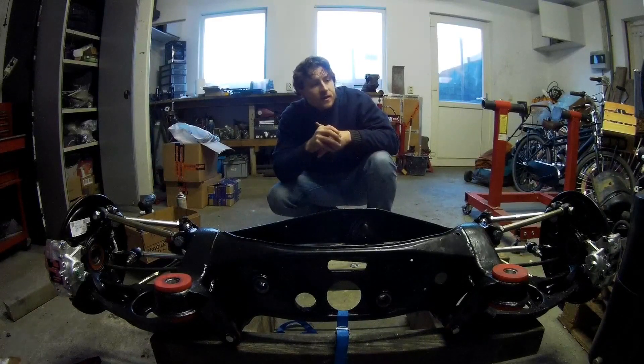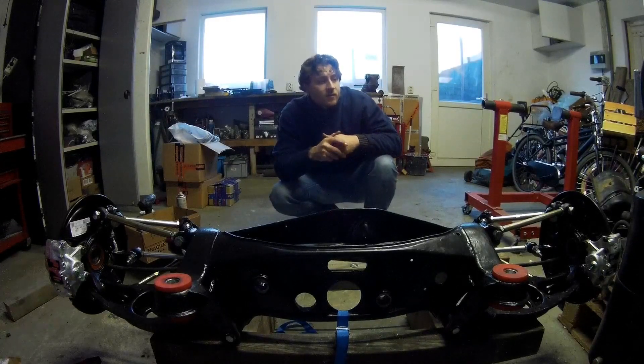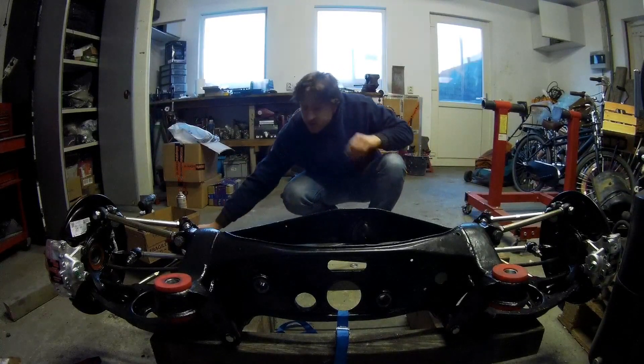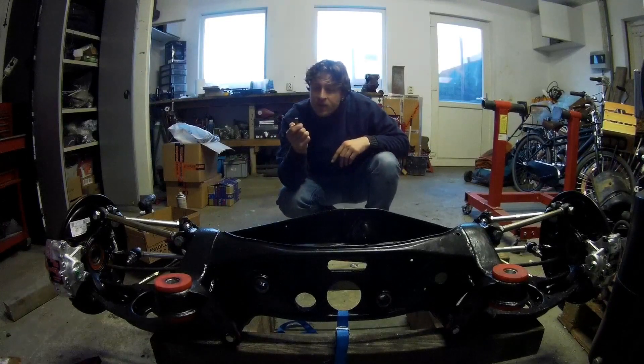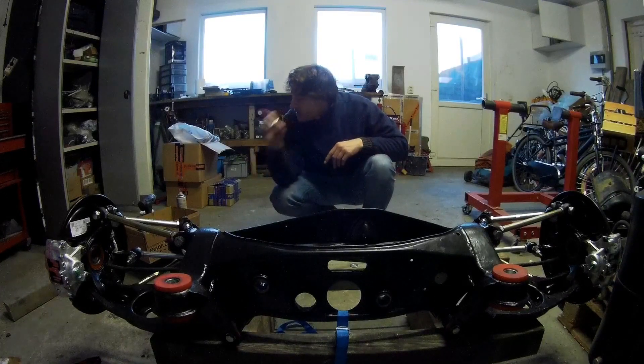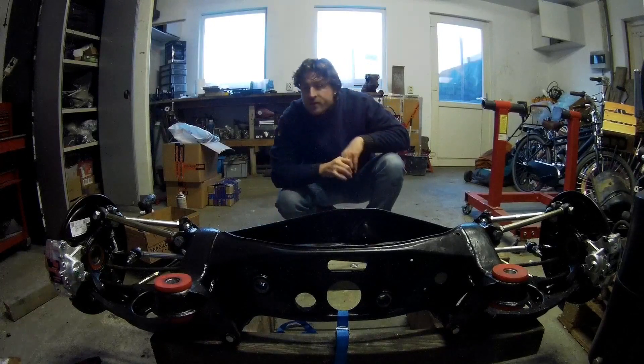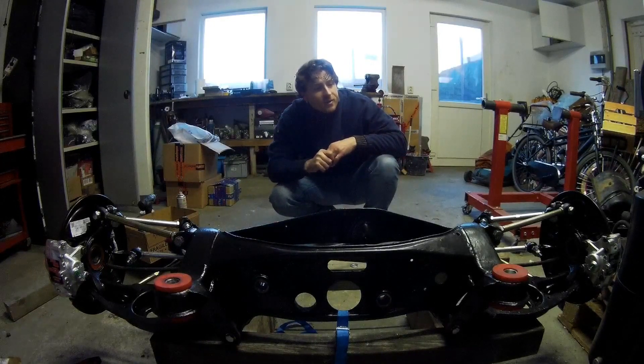All the rod ends I got from McKill Motorsports in the UK — I'll put a link below. It's pretty tight to get these bushings in. I made a tool — an M15 bolt cut off, just a piece I put in there to get them in between. I damaged one before I used the tool — one rubber is damaged so I need to order a new one. It's not that expensive. But now that it's mounted, it's very — I'm very pleased with this setup.